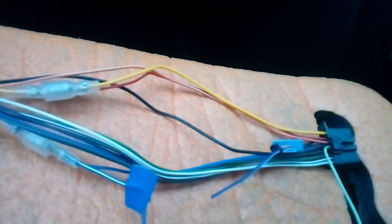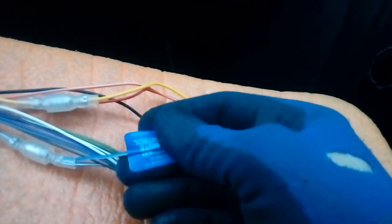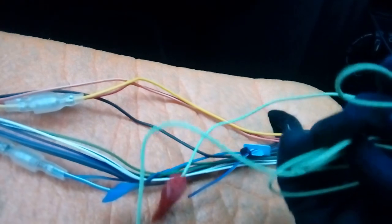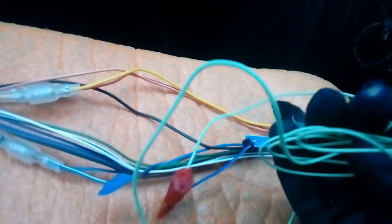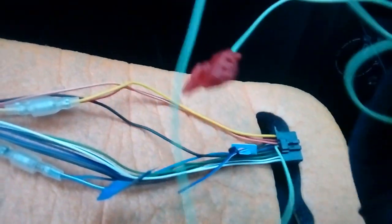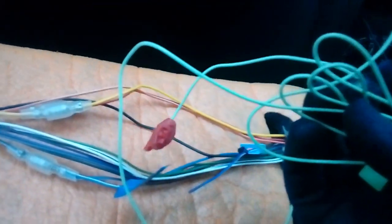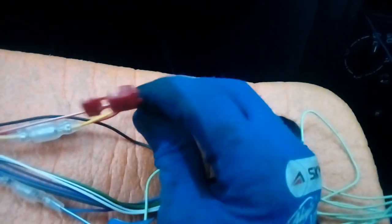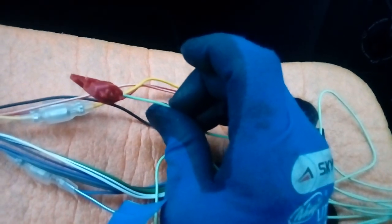Now the cable that comes with the radio: there are a couple of wires to pay attention to. One is this blue wire, which connects to the aerial adapter. The other is this long green wire — this only applies if your double din radio has a screen. Per the instruction manual, this cable needs to connect to the earthing switch on the bottom of the handbrake — that's why it's long, so you can run it all the way down the center console.